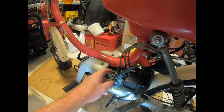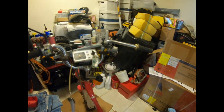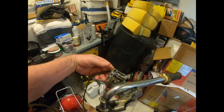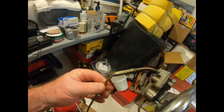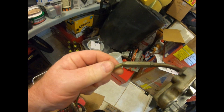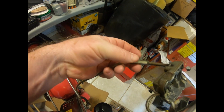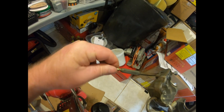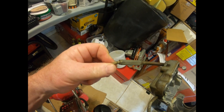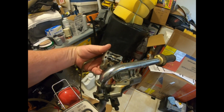I know I rebuilt the carb, cleaned it really well, and I thought I'd probably need to lubricate the cable. So I started going up to the throttle to disassemble it, to lubricate it, when I saw this. It's not being held properly — the outer casing is completely split. So it's just probably not going to act in the same manner as it would when it was new.